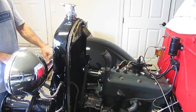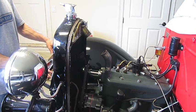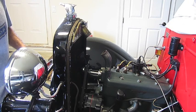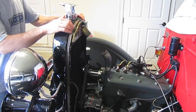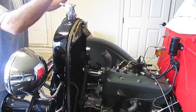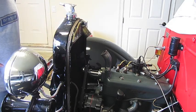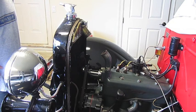There's a crossbar member in front of the radiator. You might want to wrap that with a towel or something soft as you're working to pull the radiator out so it doesn't scratch or dent. Also worth noting: you'll see a lining around the shell or cowl that's a fabric material. It's used to keep the hood from rubbing against the metal of the radiator. If that's worn out or deteriorated, it's probably worth replacing — there are small rivets that hold it in place and it's pretty cheap to buy a new strip.